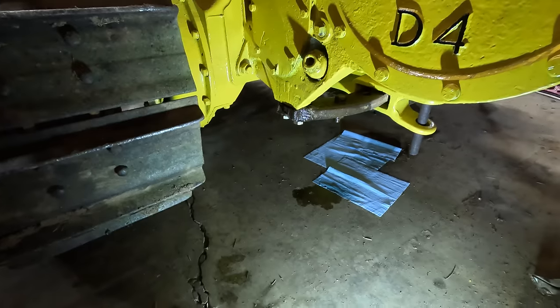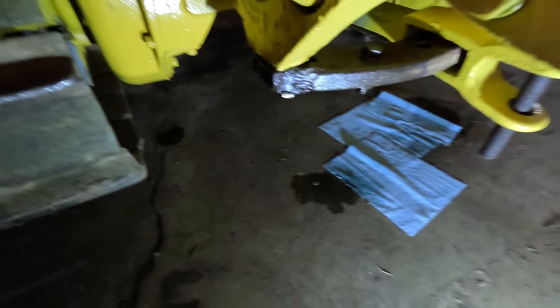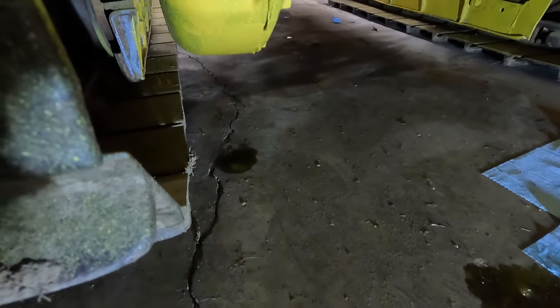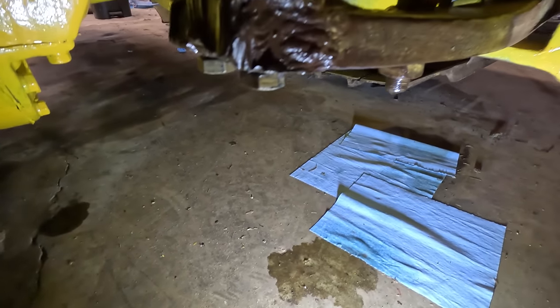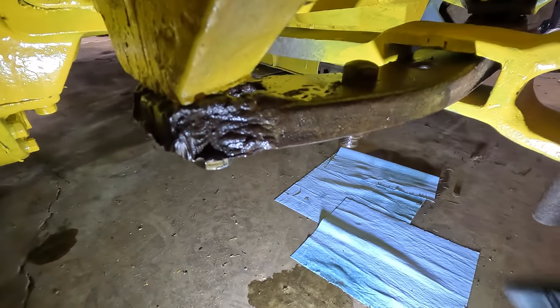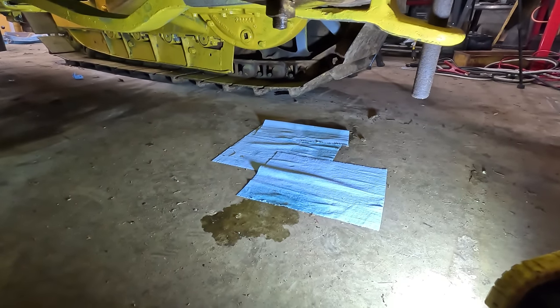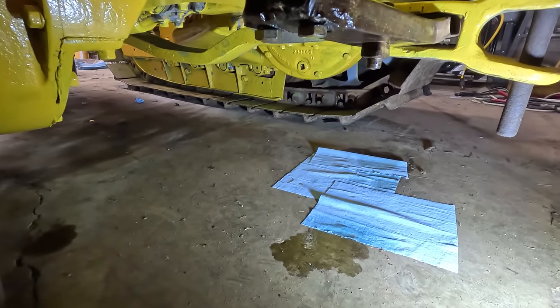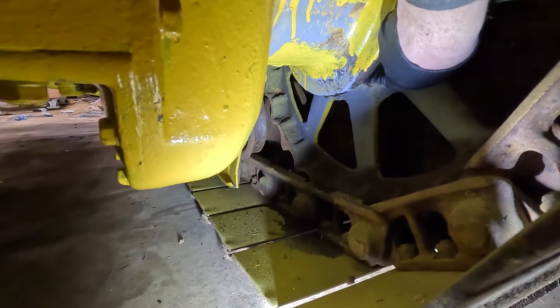That's actually really good. Okay, so back here, this would be a lower priority thing because the blade and the belly pan won't interfere. But we definitely have a leak here. We have a leak here from the winch, and I can see it pooling here. The right side final is not leaking anymore. That one was leaking before. So maybe it was just overfilled. Actually, it looks like it might be leaking. I see fresh fluid right there on that track. That's leaking on this outboard side.